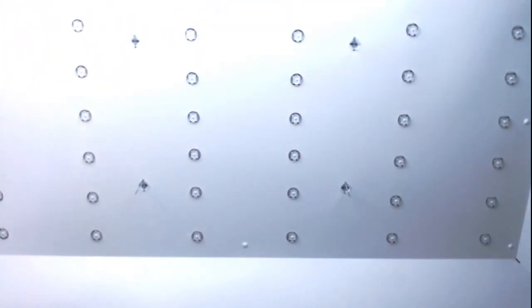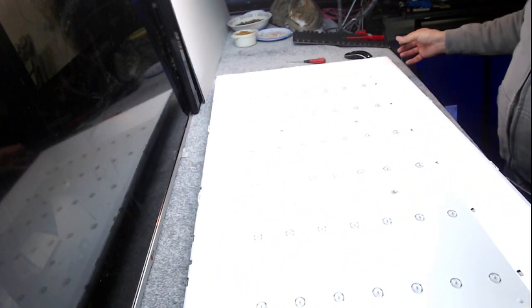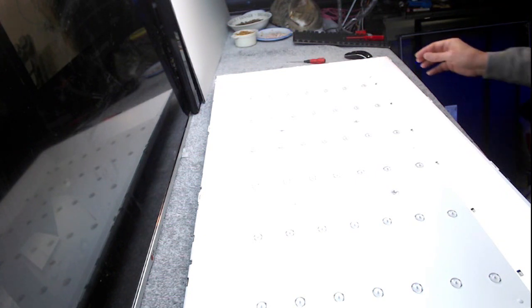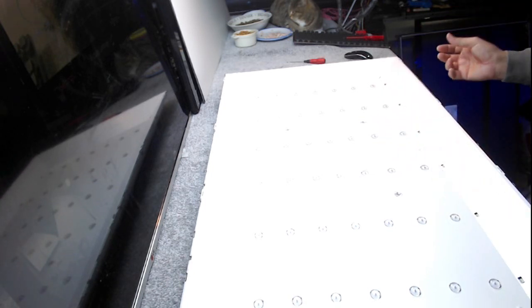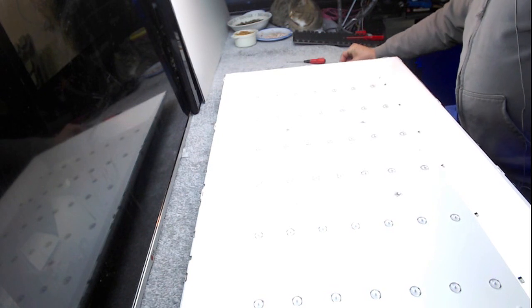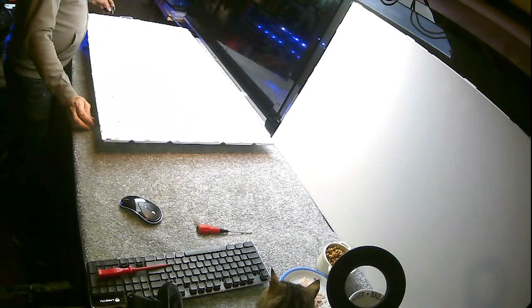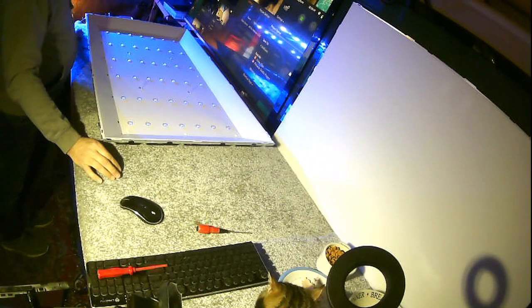A lot of people, when this fault first started, 2 or 3 years ago, or first being noticed, and when I say people, I also mean a lot of engineers, would have diagnosed this fault as a screen fault. But it's the backlights themselves. So if you've ever seen a friend's TV, or if your TV is going a bluey type picture, so many people don't notice it. It doesn't bother so many people. But this is the reason why, and I'll switch all lights off. The TV may come on, I may have to start pressing buttons, I don't know. There you go.